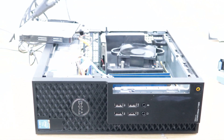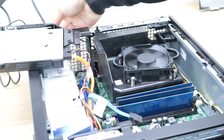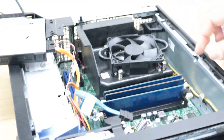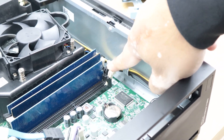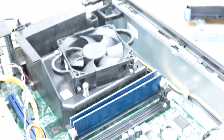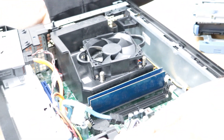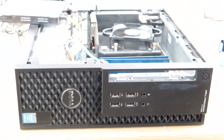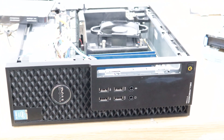So I'll move on to the second memory slot. I'm removing the power lead again. Normally I don't disconnect the USB, keyboard, mouse, or VGA cable — just the power lead. I'll push the clips, the memory comes up on both sides, and I pull it out. Connecting the power lead again — still a flashing orange light and no display on the screen.